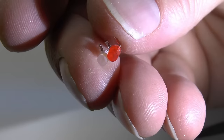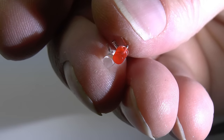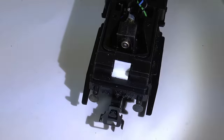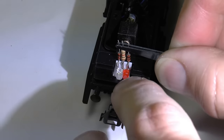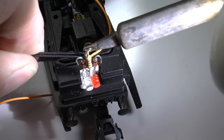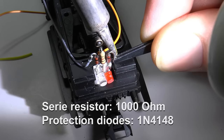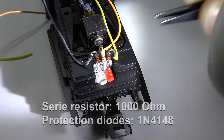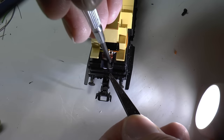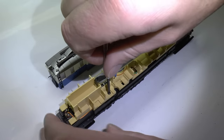We're replacing the lamp and the socket with LEDs. I soldered two 3mm diameter round LEDs to each other with a common anode. The LEDs will be held in place with double-sided adhesive pads, which will also work as an isolator against the chassis. I've also connected two diodes and a series resistor to the common pole. I cover the LEDs from the top with a piece of black tape to avoid light leak up into the cabin.